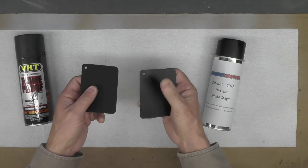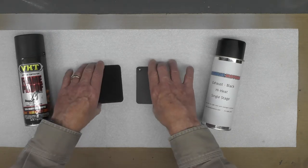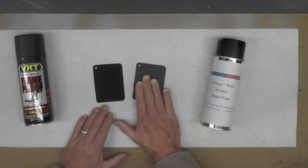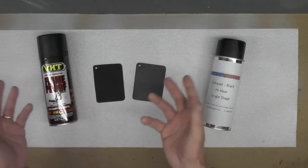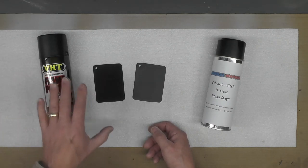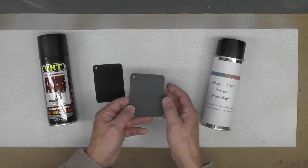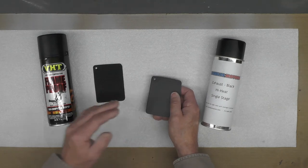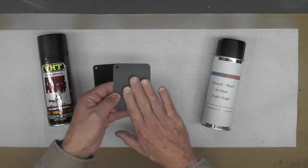I'm going to go ahead and use the Marbles Motors single stage no-bake paint on this Honda exhaust, just because of the challenges with baking it. I know I could use a heat gun and rig up a method to do it that way, but I thought I'd use this paint since this bike is not going to be used as a rider. By the way, if you're using these paints on a bike you're going to be riding on a fairly regular basis, you could certainly go with the very high heat paint that requires baking, because you'd be riding it enough to probably get the exhaust system hot enough to do the curing for you. I will nowhere near be using this Honda enough — the SL125 will not be ridden; it's a show bike, part of my collection, so it won't see enough heat-cooling cycles to cure out the exhaust.